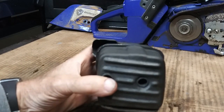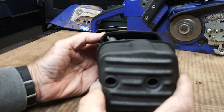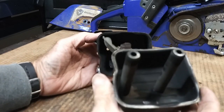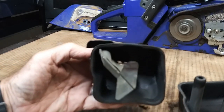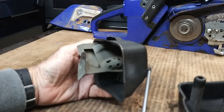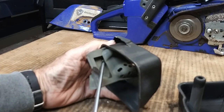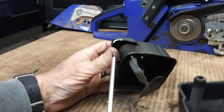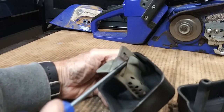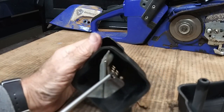As you look at the rear you can see that huge deflector that deflects all exhaust gas forward from the muffler. I'm pulling it apart slowly since I've never had it apart and don't know how things will fall. In the words of free-flowing air — this is horrific. Look at that diffuser with all those holes, but look at how much air resistance we're pumping right back into the engine. On top of that, it's got to go through that itty bitty tiny hole, make a U-turn, and come out the back. See that Torx T27 screwdriver in my hand — it barely fits in that tiny hole.